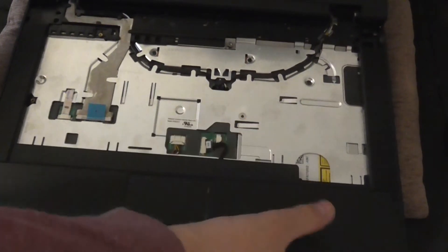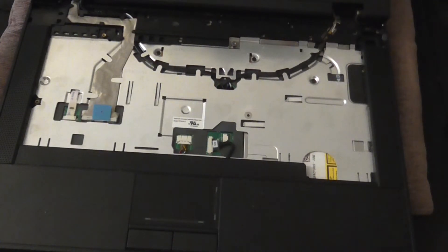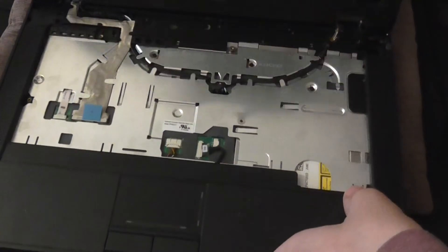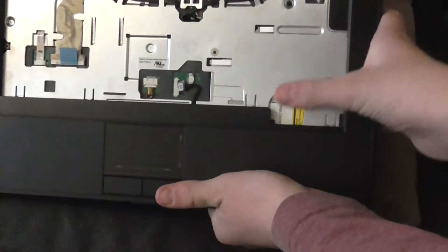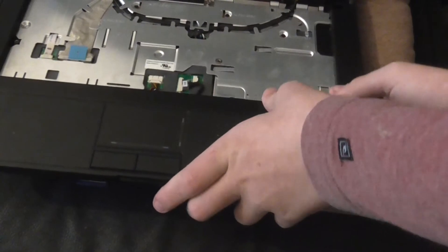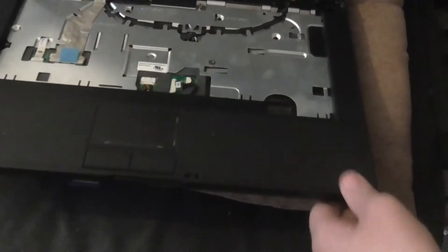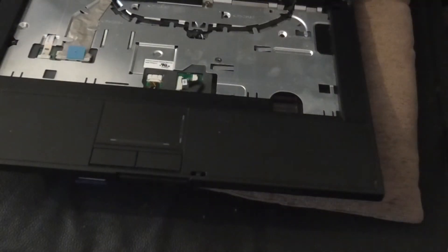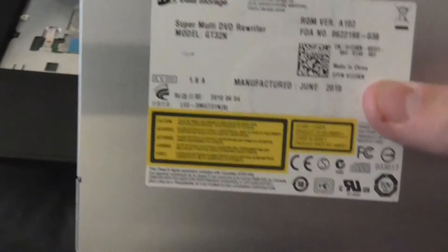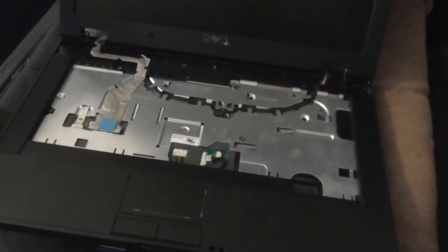So here is the optical drive — it's quite easy to do. Grab the laptop, you can lift the hinge a bit now, and then just slide out the drive. This is for the non-module bay ones. I replaced it with the one the company who sold me the computer gave me. To put it back in, just slide in the drive.